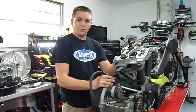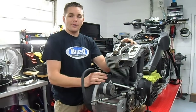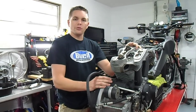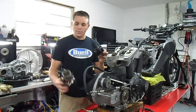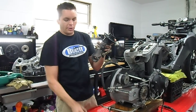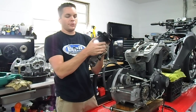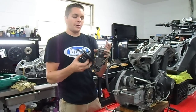This is my 2005 Buell XB12 Turbo that after a good dyno day — 187 horsepower — found a boost leak. It had the rubber coupler on the throttle body, which normally is attached with a spring clamp. That's how I had left it. The boost pressure was enough to billow the rubber boot out and leak boost past the throttle body.